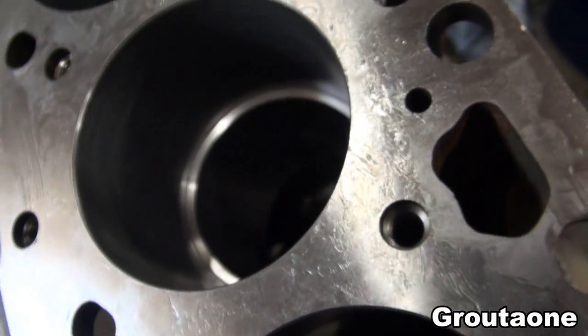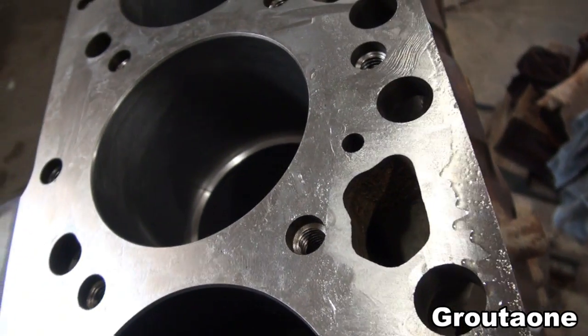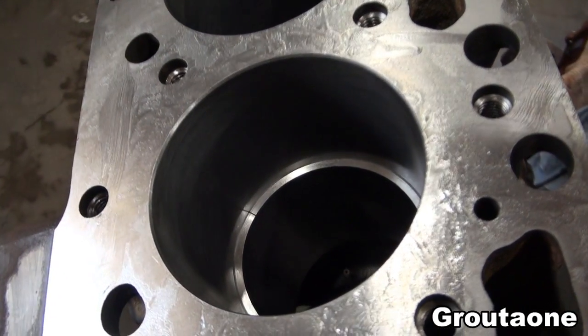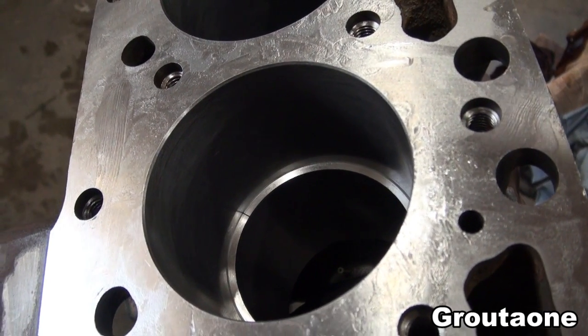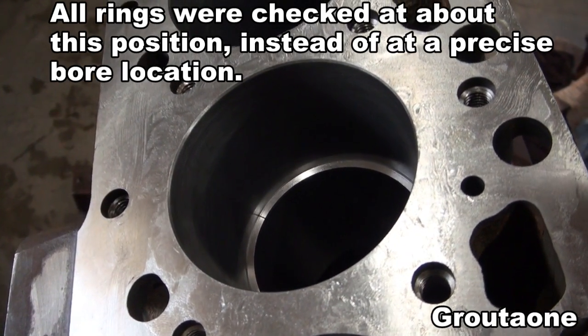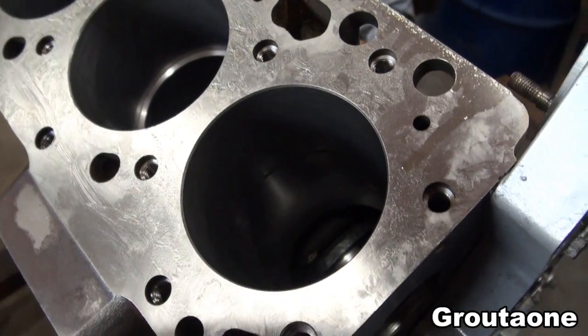There's very little wear on these cylinders. On worn cylinders, it's important that the rings are checked further down the cylinder — ideally at the point where the rings travel the furthest down, as that would be the most accurate measurement. I think these are going to be okay. All of them fit 16 thou nicely, so that should be all right.